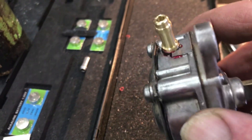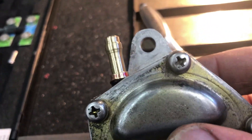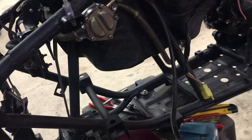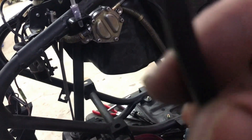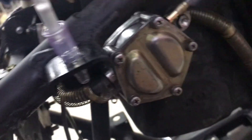That's the pump back together with the new spigot on it. The O-ring's got a bit of red Loctite holding it in - probably took me half a day to muck around with it, but why not? What's retirement for? This is a vacuum tube connected to the vacuum port on the back of the petrol pump. I've got the input lead going down to the petcock and I've got the petcock just set on prime at the moment. If I puff on this...